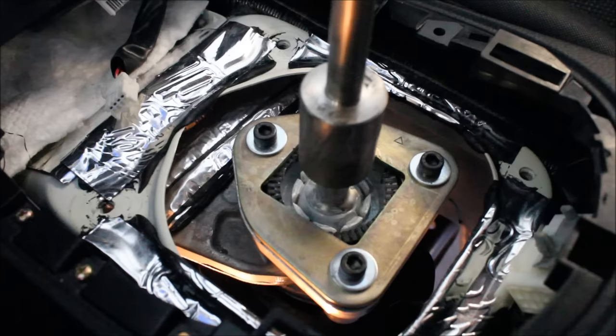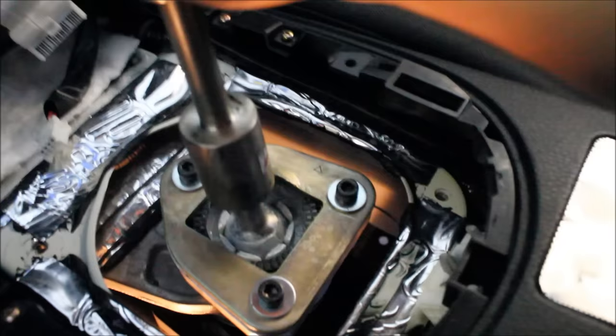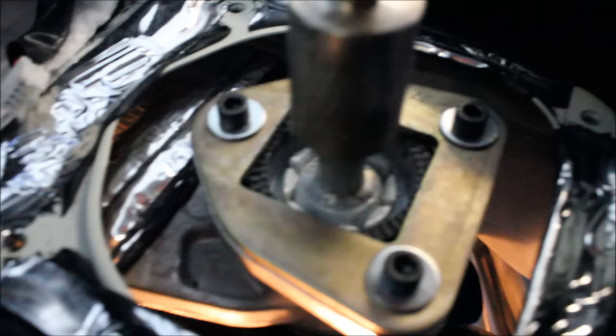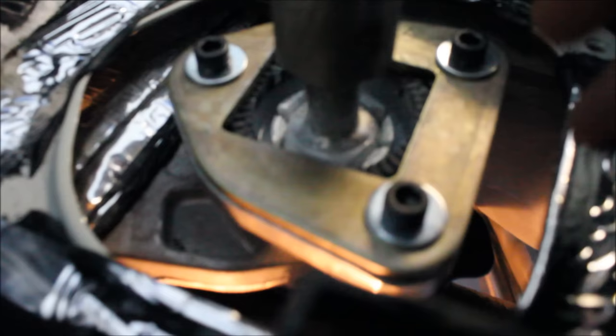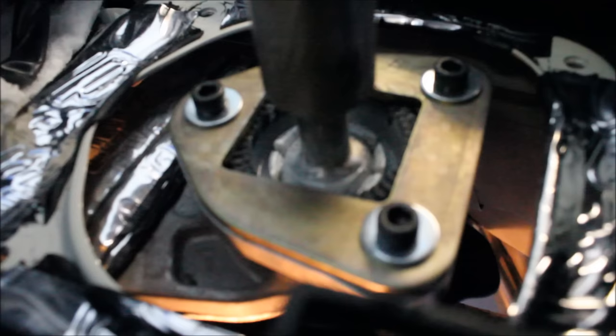Now you can see why you need that first spacer — it brings the spring up. The second spacer is cut out perfectly for this nylon cup to fit in, because it has to be able to move as the shifter goes up and down. When you're working the shifter, things are moving, so the tolerances are quite precise. When you're doing the linkage from the bottom with those ball bearings and spacers, you have to get the shifter pretty much lined up perfectly. You have to use them because they take away all the play — that's why we have such a good shift, there's no play in the system. Just be patient and get everything lined up. Don't force anything — it will all slip in.